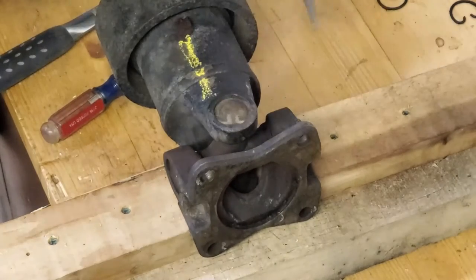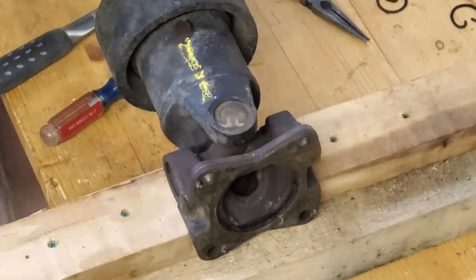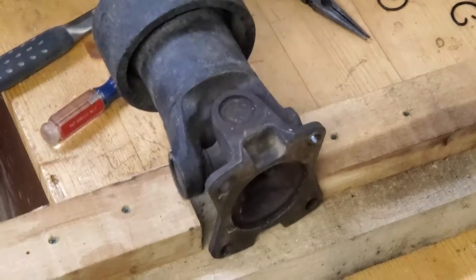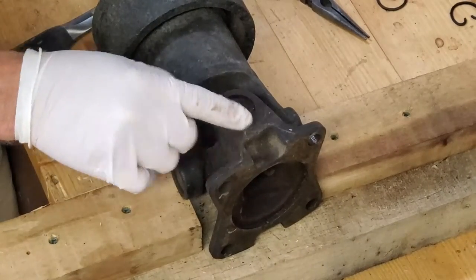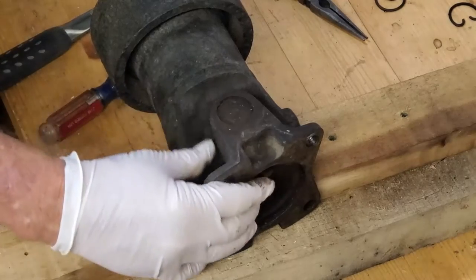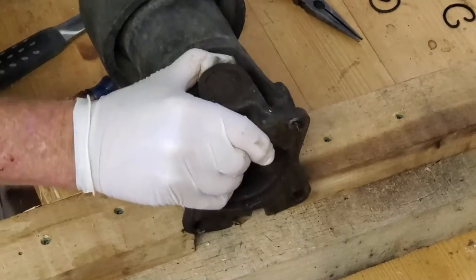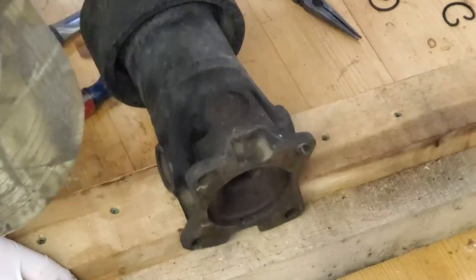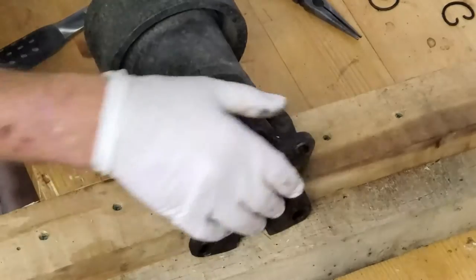There we go. And that's it. Now, what you want to make sure you do when you do this is take the flange off first. Take this off first. Don't drive this out, because then you've got to drive these out trying to hold this little piece still. As it is now, wow, you can see that one's stiff. A little too stiff. Now get that set right over the hole. You don't want to be trying to drive that thing through a solid piece of white oak.